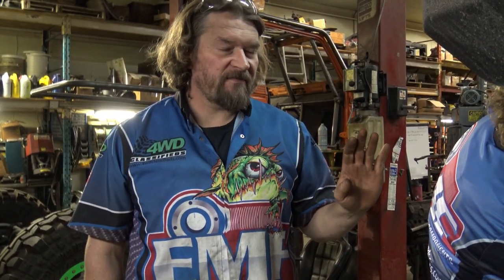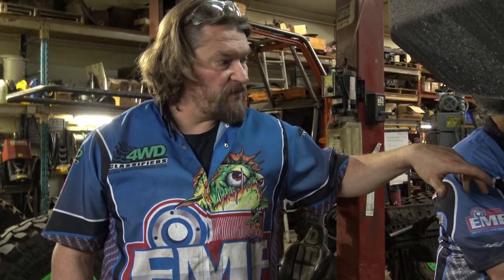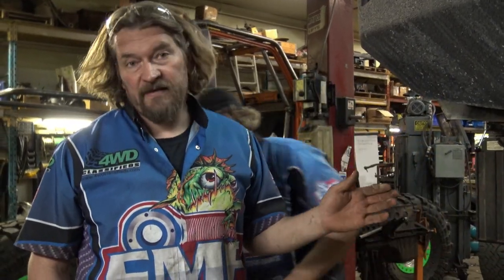Okay, making sure that the knuckle moves back and forth is a really important step. If you don't check it and the knuckle's stiff or something stiff later, you don't know if the joints were lined up properly, and it sucks having to take the bearing and the axles and everything else back off the truck. Some shops will just pound the joints on, put everything together, slap it together, and then the truck will steer weird. They're so used to just slamming ball joints in and not actually checking to see if it's free moving at this point, that they'll forget. It's not their fault, but it's just a step that we really suggest that you don't skip, because it saves a lot of shop time taking the truck back apart to see if the joints are actually the problem.